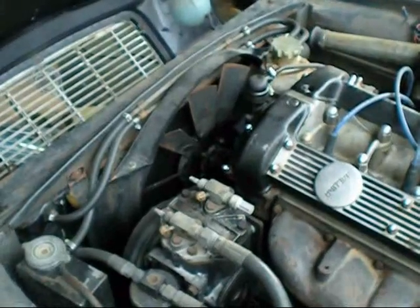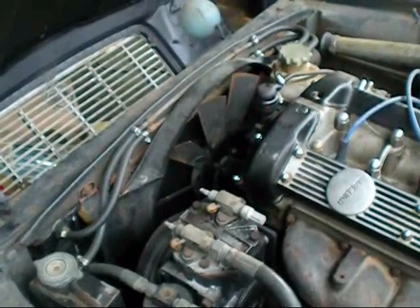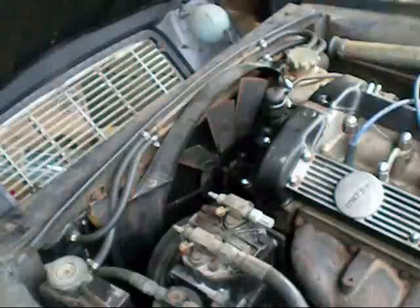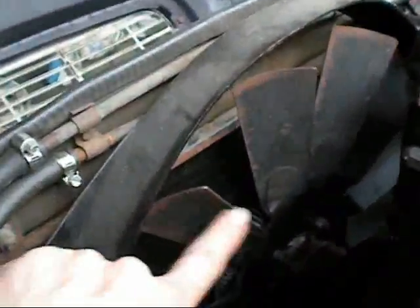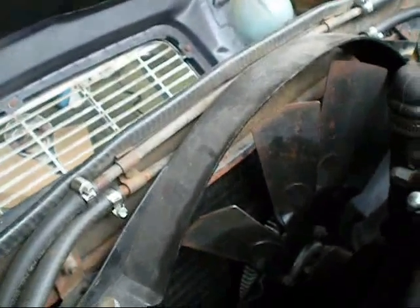Here's a good tip for people with older cars with air conditioning. If you have a rear-wheel drive car and your air conditioning doesn't seem to work very well at idle, you'll most likely find that it doesn't have an electric fan on the condenser coil. This means at idle this fan here isn't spinning very fast, and your air conditioning overheats because you haven't got enough airflow.